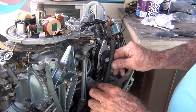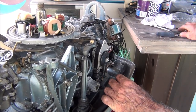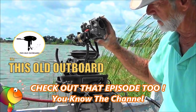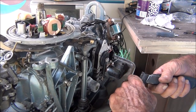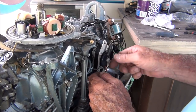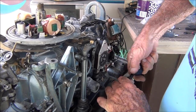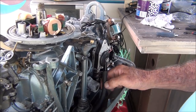So I have rebuilt this fuel pump — it's an older style pump. The reason I rebuilt it was for the '89 that's out there on the boat, when I was having all that problem. I ordered up the new diaphragm, and as it turned out, the old pump was fine. So I put the old pump back on and I'll keep this rebuilt one for the future. I'm going to put a little WD on here so she slides in. There is the fuel system on.